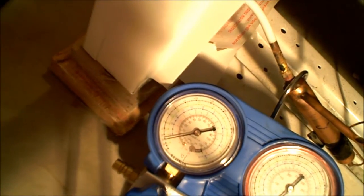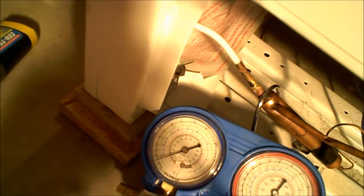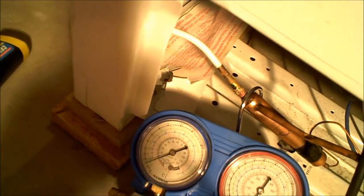Pulling right at about zero. All in all, I think I had to put in about 4 ounces of refrigerant and SuperSeal combined. My system was essentially half empty, but now all the coils in the freezer are iced up — every single coil is getting nice and cold.